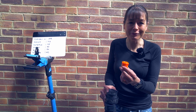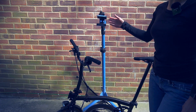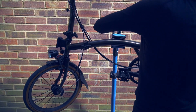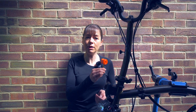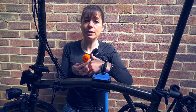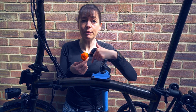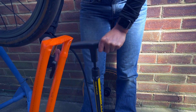Now we're going to see how it is to install. Thank you for pointing out that I had my stand upside down last week — now it's the right way up, and it is much easier to get my Brompton into. When you install the Tubalito, they recommend you only pump it up to a maximum pressure of 8 psi, then put it inside the tyre. We're not going to take you through all the steps to install the inner tube on the front and rear tyres because we have recorded videos on these — links are in the description below.